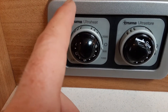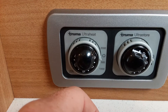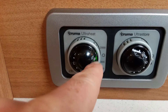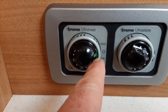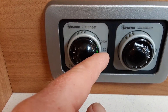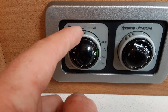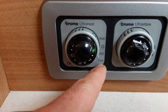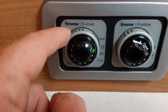Next is the switch to the right-hand side — the ultra heat, which controls the heater. This is the electric control; down the side you have 500, 1000, and 2000 watts. This relates to the amount of power coming into the caravan from the site. Here on site we can run a maximum of 500 watts. The green light indicates the heating system is working, and you can control the temperature on the central dial. If the space heater trip switch underneath the bunk is turned off, the green light will not appear. You'll need to ask the site office what power setting to use — if set to the wrong amount it will trip the site's trip switches.